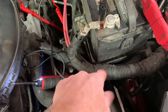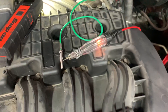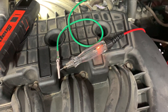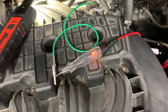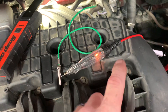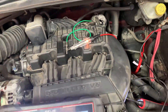I'm thinking it's going to be one of these splice packs that comes up through there. Now I have to dig and find the issue, but it just goes to show — know your tooling. The LED would have put me in the wrong direction. The power probe without using the hotshot test would have put me in the wrong direction. That's just a quick tip, guys. This is why incandescent bulbs are nice. There's not much more to say — that's just a perfect example. Thanks for watching.